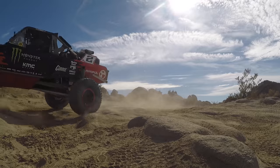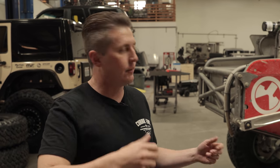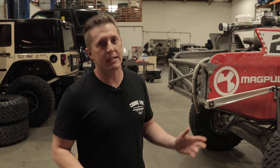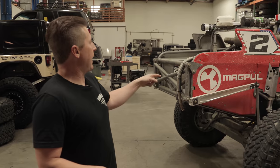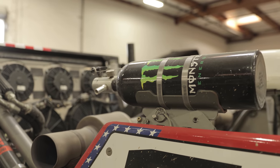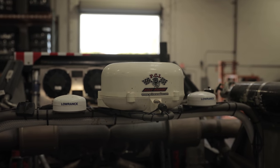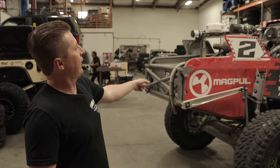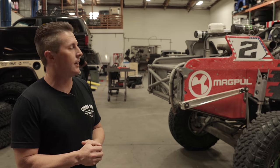One cool feature: James Lynn did an amazing job on the wiring. We have TPMS on all four corners so I know tire temperatures and pressures on every corner, and we always know tire temps and pressures when we change tires. We have temp sensors on basically everything. We did a 70-gallon fuel cell in the back, two fire extinguishers, and a suppression system underneath with a pull cord inside. We run two GPS satellites to get the best signal, and a satellite race radio for communication anywhere in the world — that's what the white dome is. The black dome next to the radiator is for live cameras on the car for live streaming.